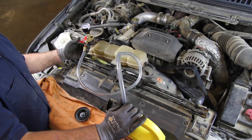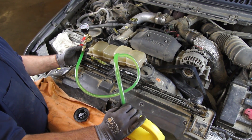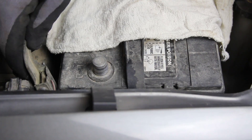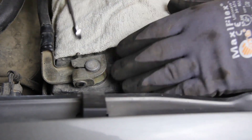We've elected to use the air lift tool to install coolant into this engine — this will eliminate any air pocket problems. Refilling the coolant system without the air lift tool will require an extensive bleeding procedure. Reinstall the negative battery cables.